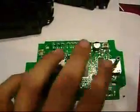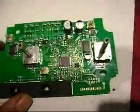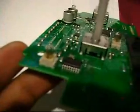Now you're wondering why there are only 2 knobs instead of 3. The other third one, that's the resistor pack. That one is intact into the case, so basically it just stays there. So looking at these things, those light bulbs right here, same thing. They're cheap. They're the ones with the socket, exactly like the upper part of the console. Those are the cheapest thing you can ever use on a circuit board to light it up. I don't know why they didn't use LEDs, but to heck with it, that's what I'm going to be doing.